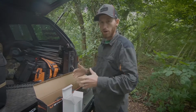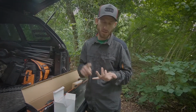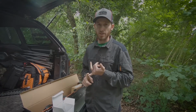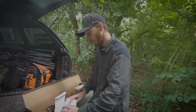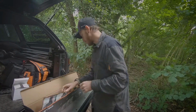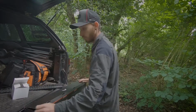And then you get the smart harness, which is comprised of a 60 amp relay, all the wiring for your switching. You've got your positive negative current wiring in there, and then it has a connection to your piggyback connector. So we'll show you that when we get to the front of the truck. And in the box you get simple wiring instructions, some zip ties, and the basic componentry you need for your lights.